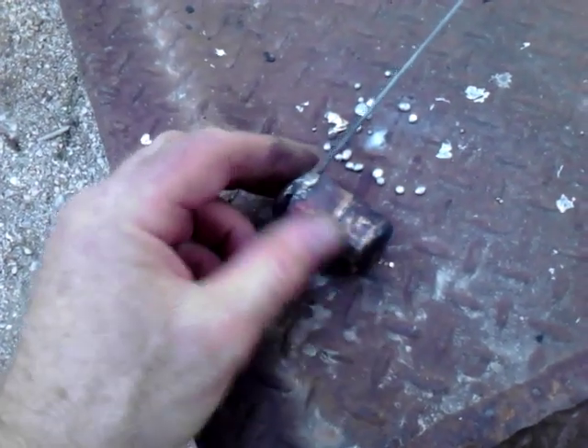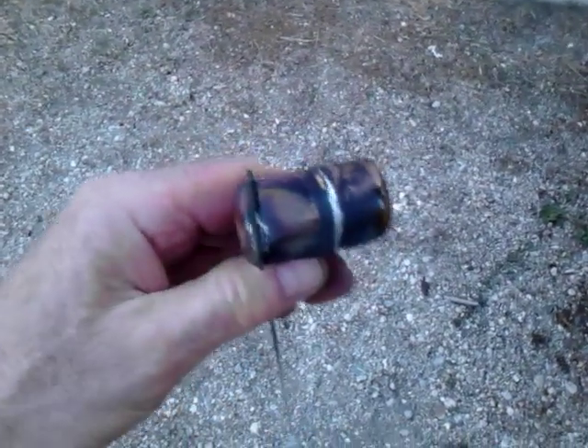Because it's such thin material — that float is just paper thin. You touch it like that and it gets hot instantly, then it melts the solder. Because it's that paper thin, I was getting solder inside it. That's why you can hear that solder rattling in there.